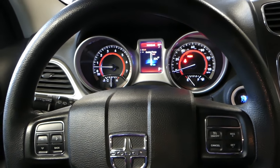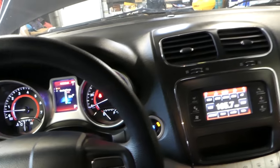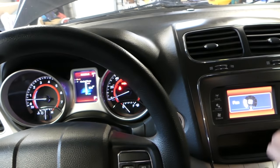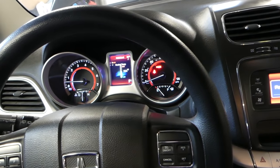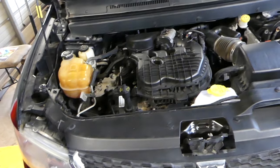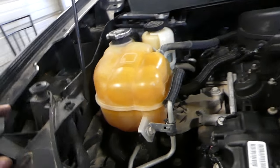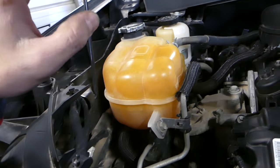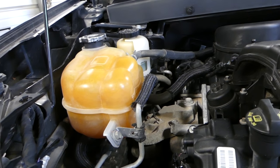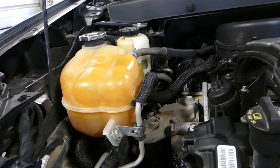Ours is not overheating at all. At 230°F the fan will turn on, but the car doesn't overheat. The heater feels really warm on the left, right, and back — make sure you have heat in the third row if applicable. For the next step, turn the car off. The coolant will be extremely hot, so never open the cap. Let the engine sit overnight; if there are any air pockets it will draw in more coolant. Later, just add coolant as needed, and if you suspect air pockets, repeat the same procedure. Test drive a short distance while monitoring the temperature gauge — that should be all.